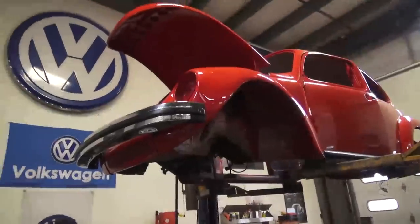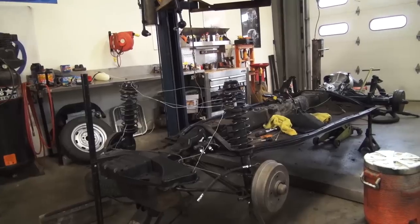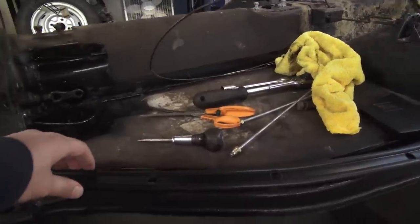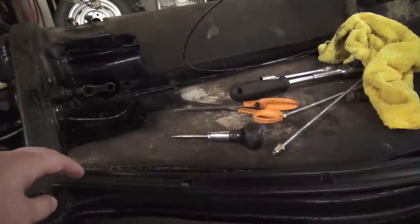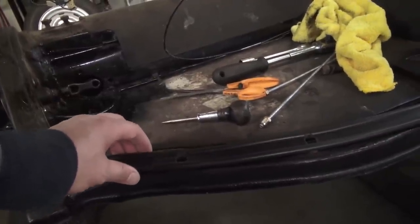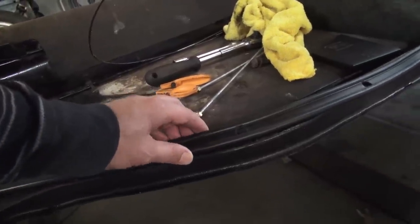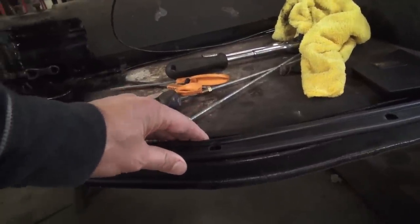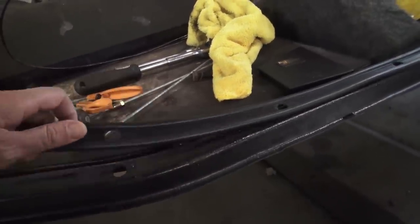We have a jack there and a jack over here. Now this car is all original — it was never restored in the past and never separated from the chassis before. A couple of things I learned about the later models: when I took the shell off this chassis, there was a sponge-style type seal that mounted to the floor pans with a self-adhesive back to it. It was very sticky, kind of gooey, and I was scraping this stuff off. That was the kind of seal they used. I'm used to the older style seals that earlier Beetles had, which is just a rubber seal, and there were usually a few tacks that held the seal in place around the bends to keep it on the chassis as you were marrying the body back down so it didn't move. I guess later on they used a self-adhesive type seal, because these are the original floor pans and there were no nails in the floors to hold the seal in place.